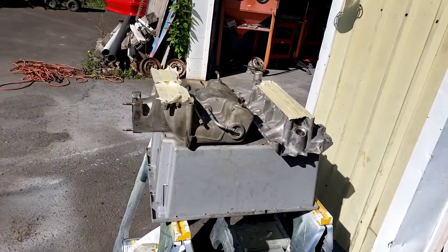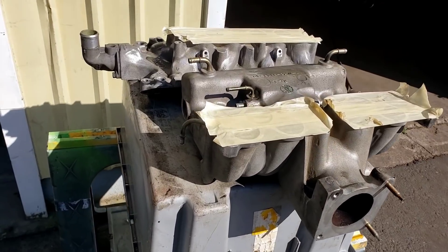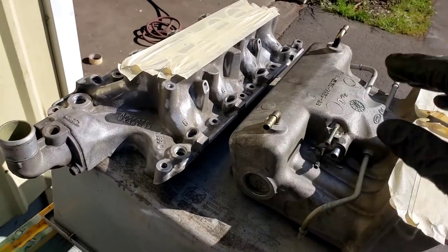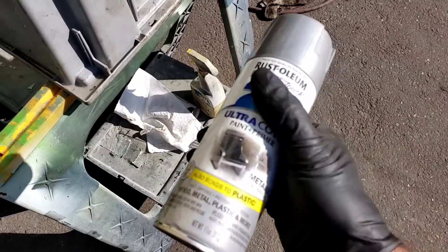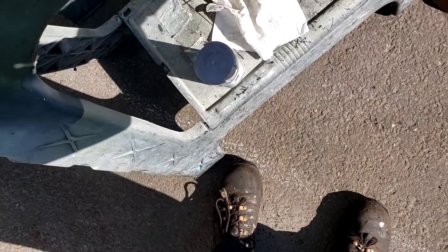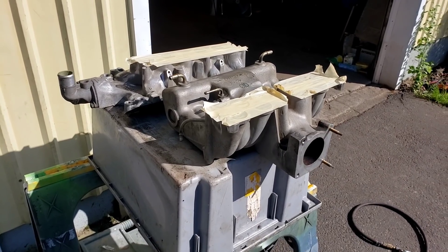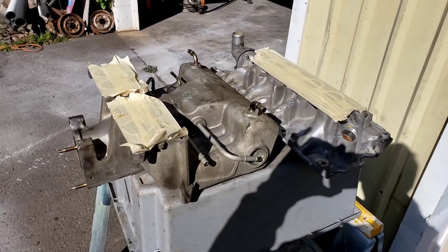We power washed our manifolds here for our Ford. Got them as clean as we could — not as clean as I'd like, but I really don't want to sandblast them. They're drying here in the sun. I got the ports masked off and the can of paint just warming up in the sun. We're gonna go ahead and spray them. I also took some wax and grease remover and wiped them down to make sure there's no grease, gum, or varnish. It's all in the prep — painting is always 95% prep, 5% spray.